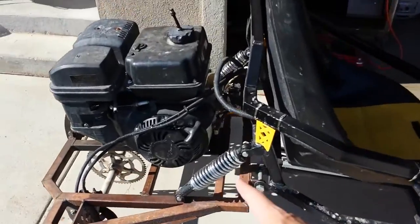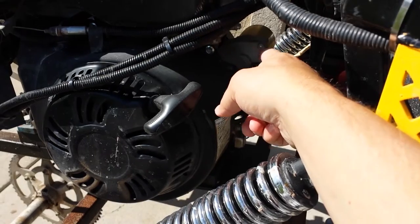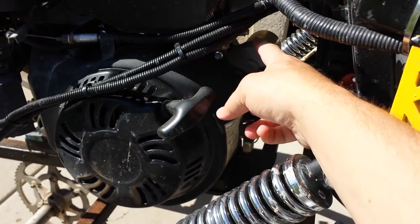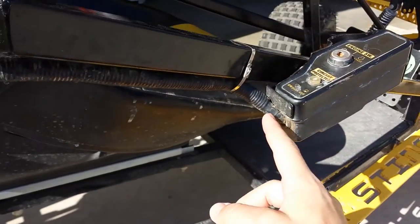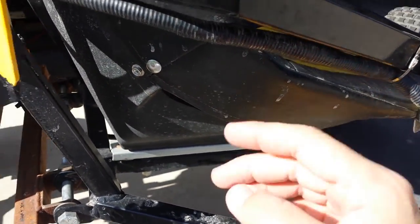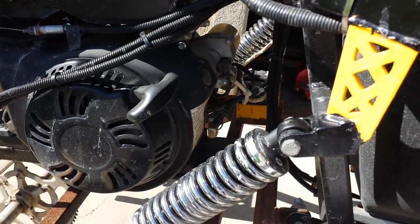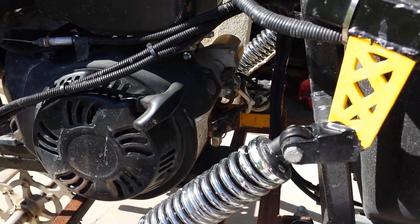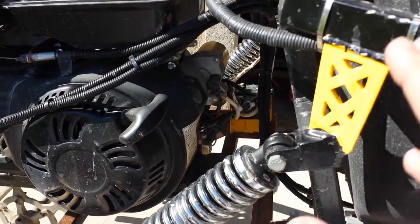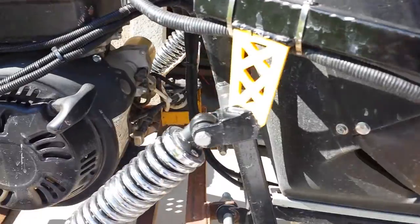All you have to do is remove the bolts that are holding it onto the frame over here, or the motor. Then somewhere in the middle, don't clip it really close to this end. Give yourself a little bit of room, but go ahead and clip the wires. Get yourself some new wire and some connectors and just lengthen it out. Connect all the new wires, lengthen it to what you need, and everything's connected.